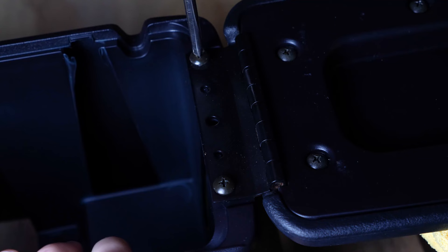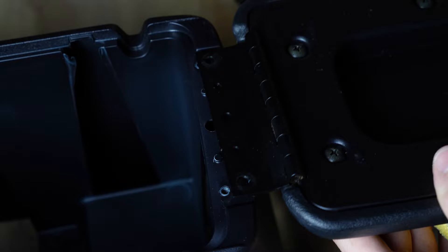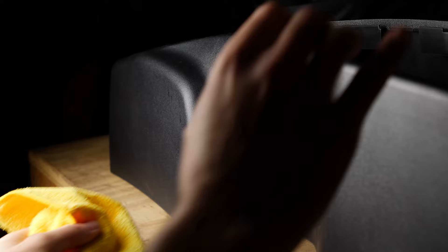To get started on the console we need to remove the armrest — just the two screws on the hinge. But make sure to support the armrest while you do this so you don't strip or damage the holes. Now it's time for the final cleaning prep before we get into the thick of it. Isopropyl alcohol on a microfiber towel should be enough to remove any residue left over from your hands or any dirt that might have been left over from washing earlier. This also tends to dry out the plastic a bit, which may help with the fabric adhering and forming a bond later.